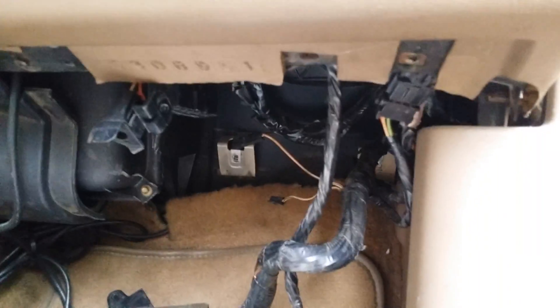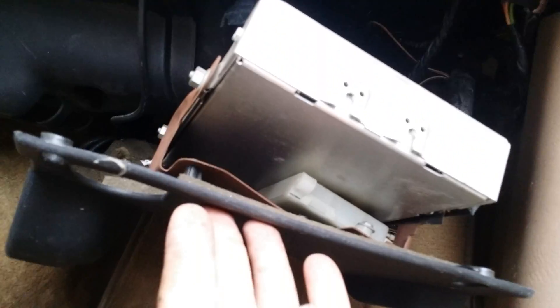Remove this panel from up in here - there's your ECM. You want to find this wire, which was actually taped to the wiring harness. I untaped it and then you want to unplug it. The camera can't zoom very well, but it's a brown wire with a black stripe on one side, and the other side also has a black stripe. Unhook that - very important.